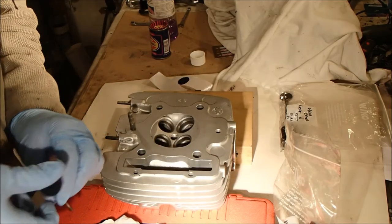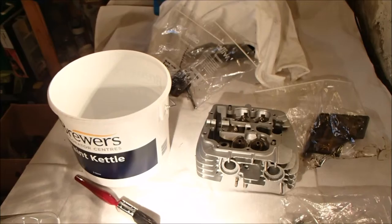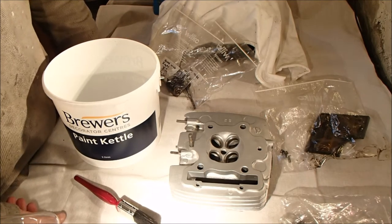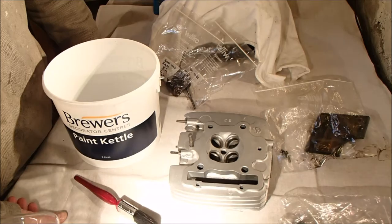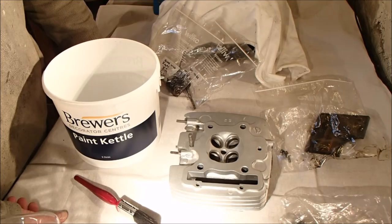Now I'm just going to clean this up, put a bit of oil on it, and stick it in the right shaft and get to grinding. The valves have now been lapped, so I can reinstall them into the head - which is the first bit of real installation since the project began, everything else having been dismantling or sent off for repair. I'm still waiting for parts ordered two weeks ago, including a cam chain the supplier sent incorrectly.